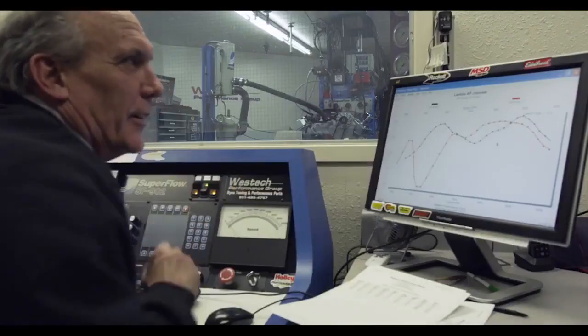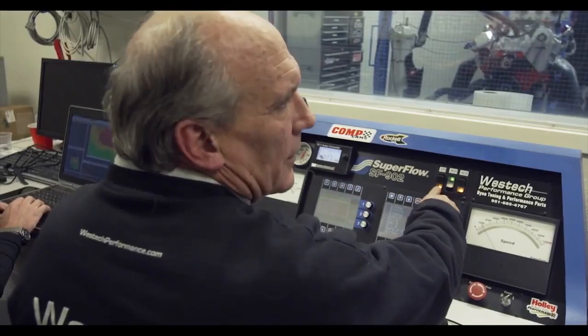So we're in the control room right now. The engine starts and runs really good. The last pull we just did matched the horsepower peak from when it ran with a carburetor. All things being equal, the carburetor should technically make a little bit more power because of vaporization and the cooling qualities in the intake manifold. But when you compare throttle bodies with carburetors, you remove the booster out of the carburetor, so you basically have more CFM with the EFI throttle body. It's a give and take — I've seen it go both ways — but certainly from a drivability standpoint, fuel injection kind of has it hands down over a carburetor.